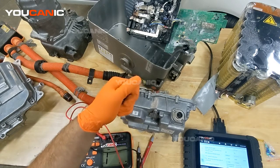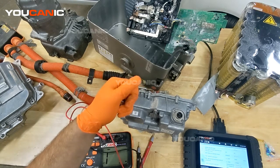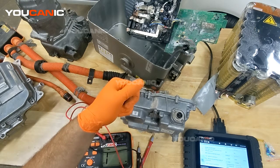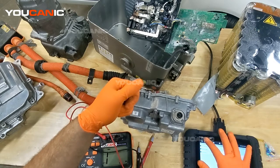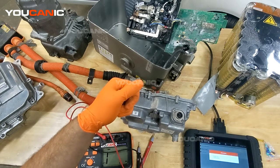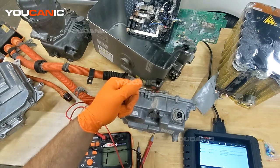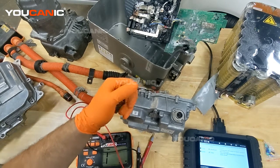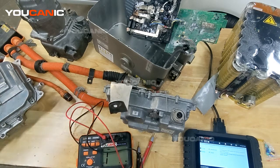That's how you troubleshoot an insulation resistance issue on a hybrid vehicle. This is a 2010 Mercedes S400, but the principle is the same across vehicles. We have an article that goes more in depth on common codes — different manufacturers trigger different fault codes in the BMS when this issue occurs, but the concept is the same. All manufacturers perform this check on their hybrid and electric vehicles to prevent people from getting shocked and to protect the vehicle's electrical circuits. Thank you for watching Mechanic, where you can be the mechanic.